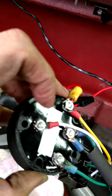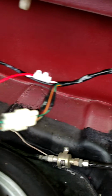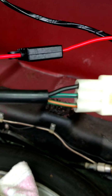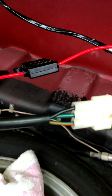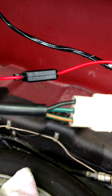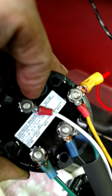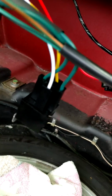Now, what do I have this relay hanging out here for? Okay, the alarm is a ground. It pulls to ground, and the original alarm for the Lotus was not working in that sense. It's got that green with orange wire and then ground, and when they get connected, that sends a signal up to a module which turns on the low fuel light 15 seconds later if it continues to receive a shorted connected signal. So what I did was I took a relay and took the alarm and the positive that I have and connected it to the relay.